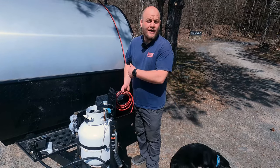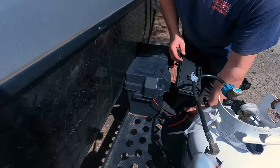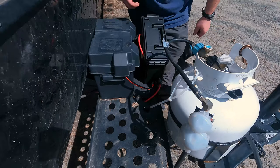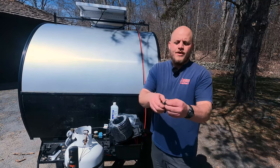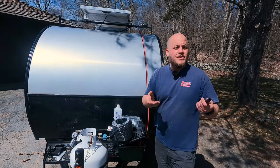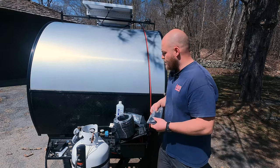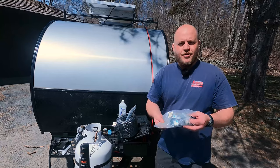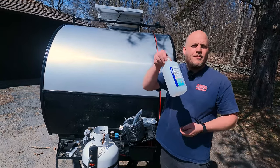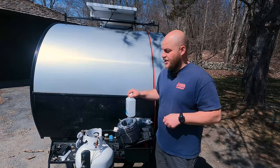I've now run both my wires from the battery and from the panel inside this box and I leave them long for now. Now we're ready to cover things in wire loom. To dress this exposed wire up we're going to use split wire loom that comes in a spool — it's very inexpensive and UV protected, and if we take our time it looks a lot nicer when the job is done. I'm going to use some zip ties and electric tape to tighten up the wire loom. One of my favorite parts is using these little 3M zip ties with an adhesive pad. I prep the surface with a little rubbing alcohol, let it dry, and then they stick on — makes for a much cleaner job that lasts longer.